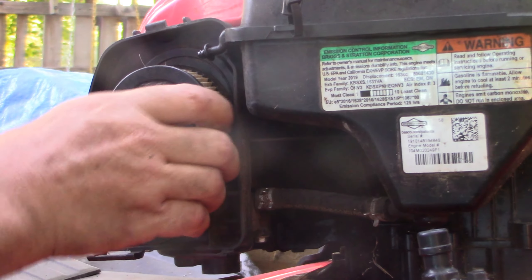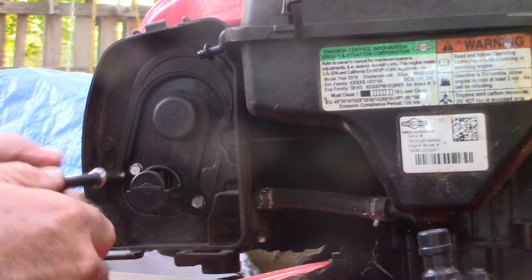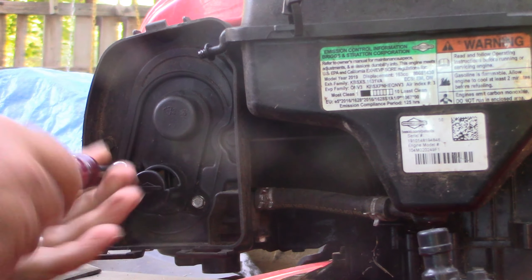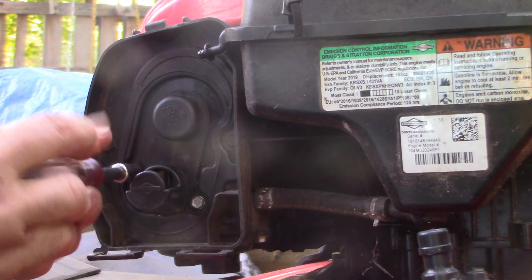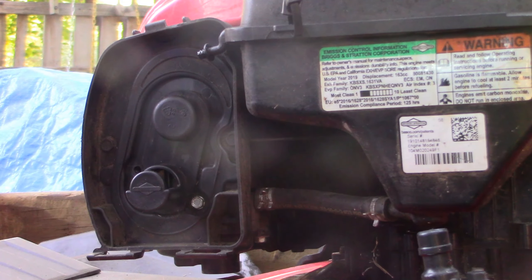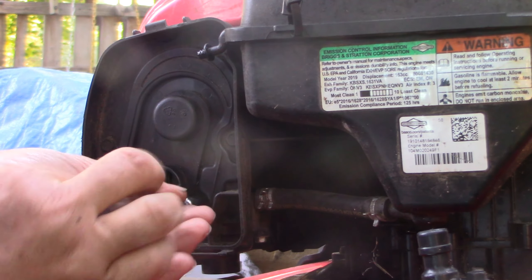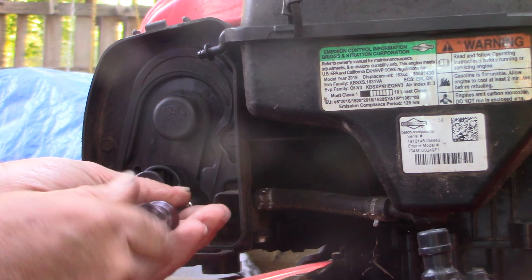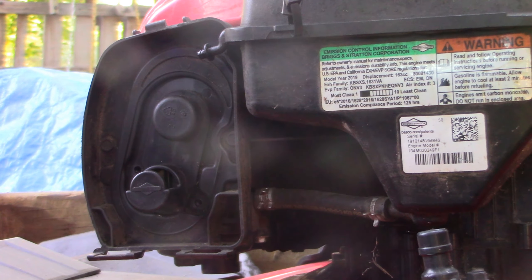Open the air cleaner and remove the air filter. Next, we've got two screws that are 9/32s — not 5/16ths, just one step down from that, 9/32nd. They go into the plastic carburetor, so when we reinstall it, you don't want to go nuts. They're just going into plastic — you don't have to tighten them that much.